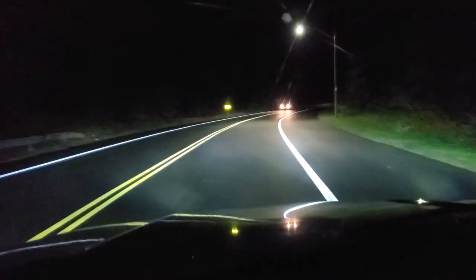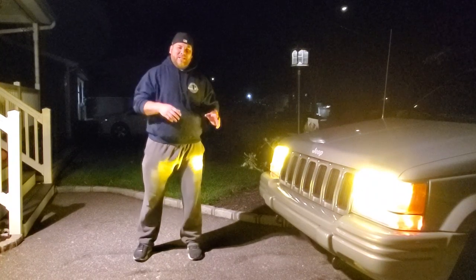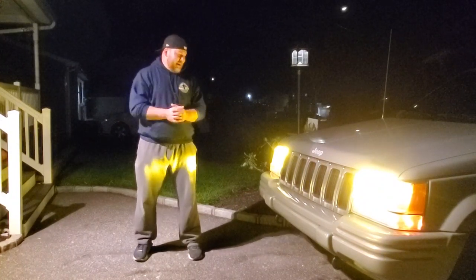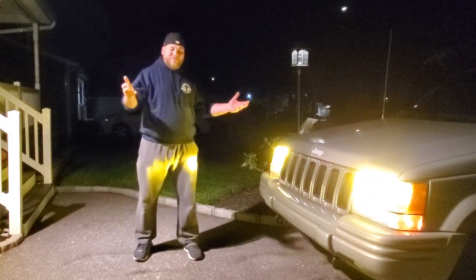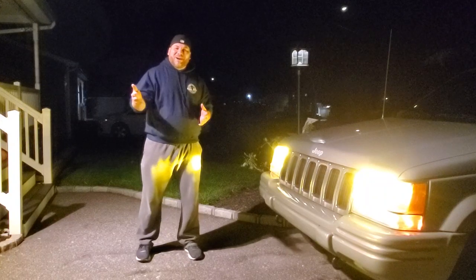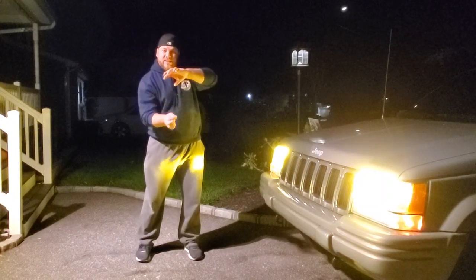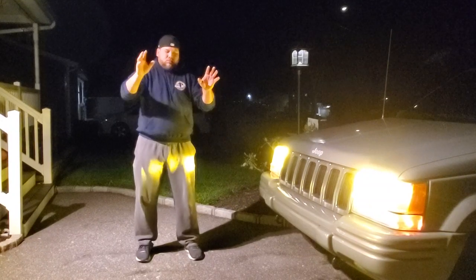We're going to wrap up this Boslla headlight video. These bulbs are amazing — LED, super bright, and in white configuration they're amazing. We also have the amber option. I haven't had a chance to experience them in the snow but it will happen — it's almost that time of year. Super easy install: just pop out the old bulbs, pop these in, and do one extra plug. So far I've got three out of four functions — I haven't been able to switch it to the flasher mode yet, I'll have to read the instructions. One installation tip: make sure the wire coming out of the back is rotated to the six o'clock position — I had them reversed and the high beams were pointing down. Also, I need to get new locking rings for these ZJ headlights as the old ones wouldn't lock in, and while driving I can notice them wiggling around.